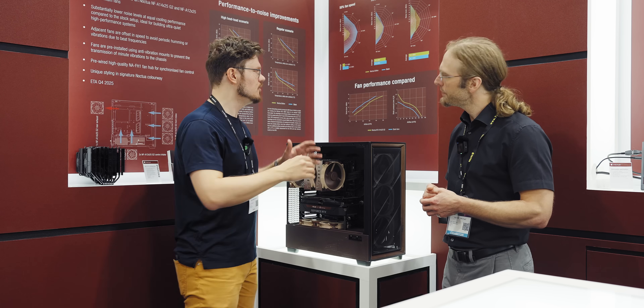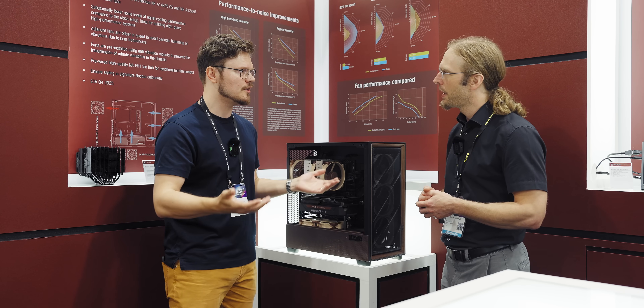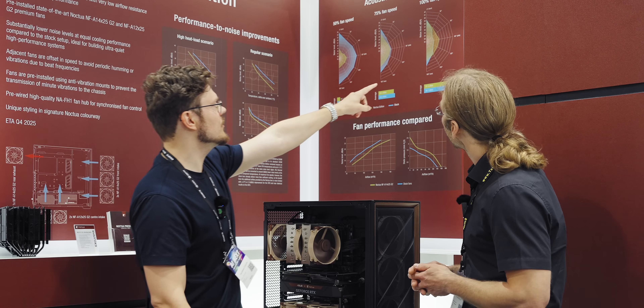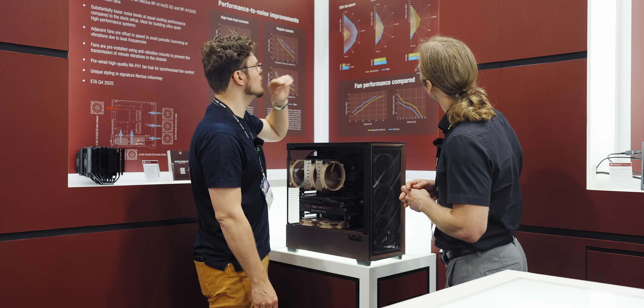On the topic of noise, you guys tested different directions. What did you find? Very interesting from a case reviewer's perspective — we did a lot of acoustic directivity testing, not just measuring from one angle, but going from the front all the way to the back of the case in 30-degree steps. As you can see in the charts, the noise levels actually differ quite a bit per angle, and we also see different acoustic directivity responses from the different configurations. With 100% fan speed on the Noctua enclosure, you're actually looking at higher or lower levels at 90 degrees.